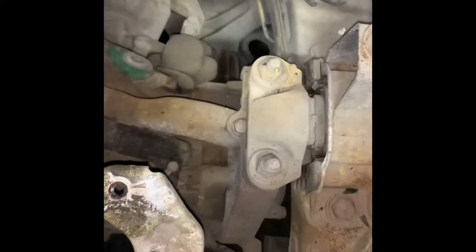You might have a pipe in the back of this — the filler pipe — just like that. Get it out, now we can see our top gearbox mount and also get access to the gear linkage and things like that.